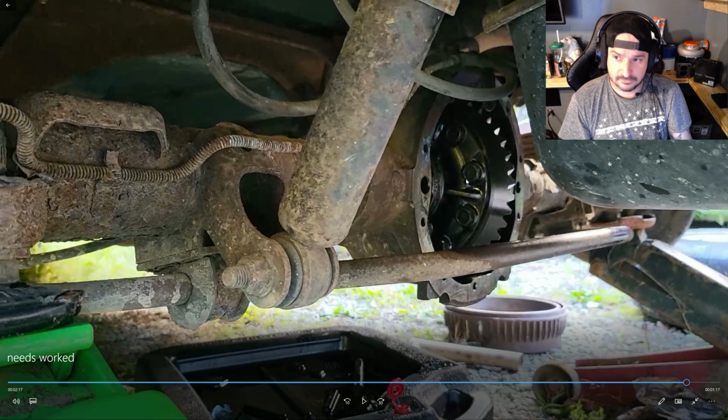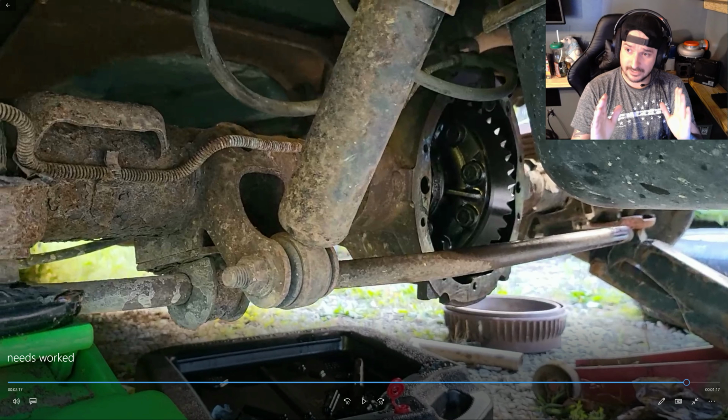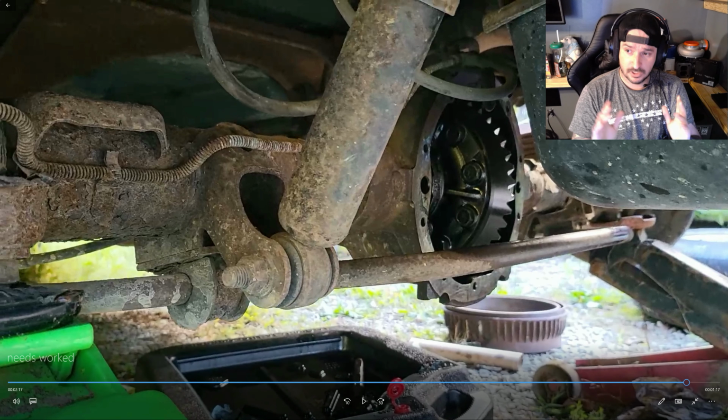The second side, no shims. Don't use your shims. Put it in. Once you get both sides lined up and splined into your axles, put your C-clips back on your axles. Make sure they're seated and pull your axles back.